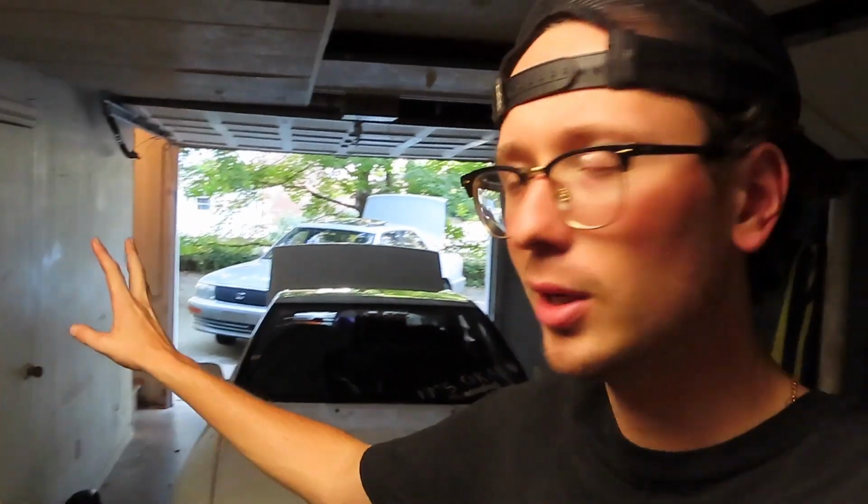This is as far as I've gotten for literally jacking up the front. I'm happy with my rear fitment. I do have a lot of room to go lower in the rear. The front I maxed out and still have too much wheel gap, especially on 17s. So gotta do a couple things. Obviously gotta pick up some washers. I gotta roll the front fenders. I have to make sure all this stuff is gonna clear, make sure my uppers are gonna clear. Worst case, hear me out, put springs back in.